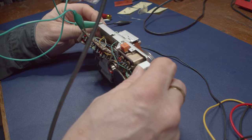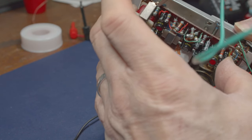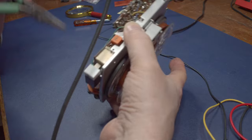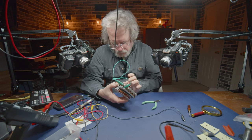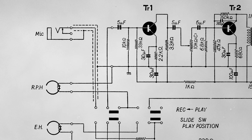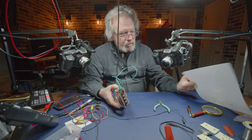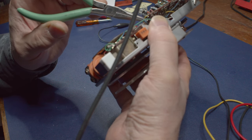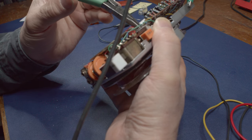I haven't really been on this side of the board much. What I've noticed in play mode is that I can get it to work by moving this board around - and as I've stated, these tiny wires are just so easily broken. The negative wire coming from the tape head, which is supposed to go to ground based on the schematic - the blue wire going to chassis ground - it broke off just moving that board around a little bit, and here it is just hanging in midair.